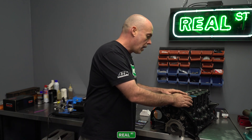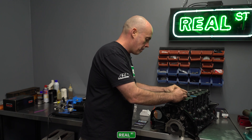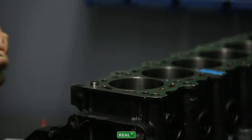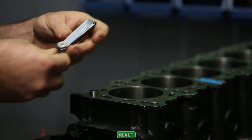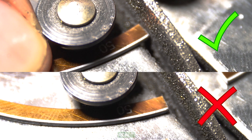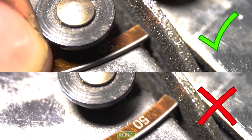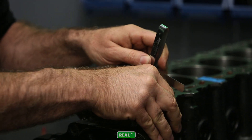After a few passes, you're going to go back, re-square the ring, and measure again. When you put the ring in the filing tool, make sure that you have the ring square against the cutter so you don't end up cutting a taper into the end of the ring. It's easy to take material off and it is hard to put material back.